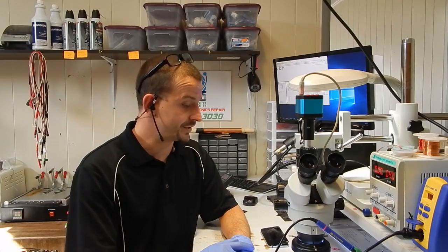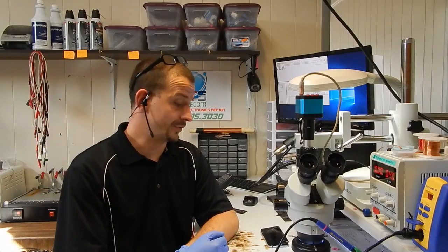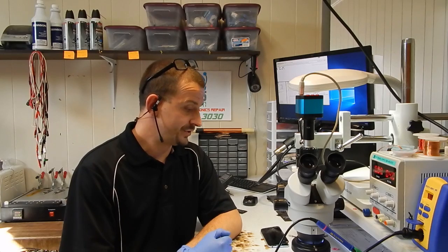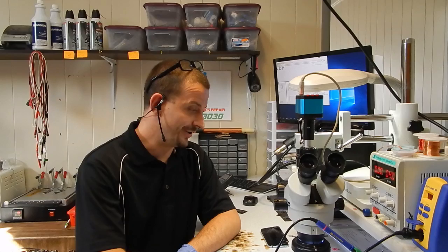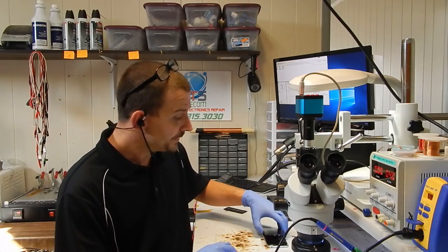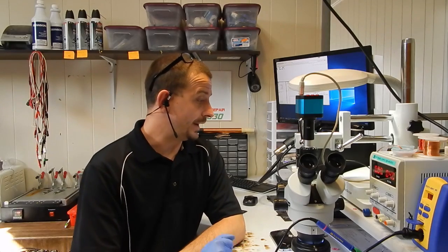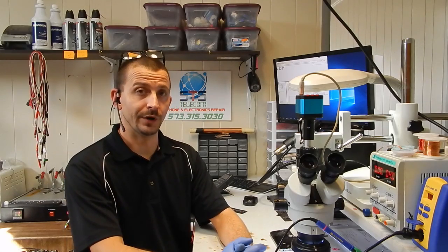Really a super easy data recovery. At first glance I thought I was going to get into a really long drawn-out video to fix this one, but as it turns out, even though it had some stuff knocked to the side, that was not the source of the no-power situation. This was just a capacitor on VCC main shorted to ground. Watch this thing work after I'm done — get service — and this customer will be completely happy. So I'm going to do an iTunes backup, ultrasonic clean it, and send the customer your repair is complete. I hope you all have successful repairs, and thank you for watching.